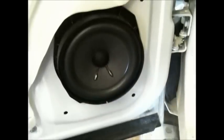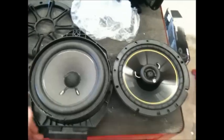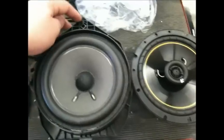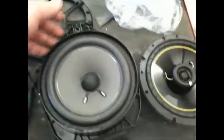And that's it, guys, and that's supposedly the best premium sound system speaker, Bose. Let's get that out of there. Alrighty, guys, here's the Bose speaker out right now. To remove it, all you need is a 7-millimeter screw that comes right out, and then this guy, just put a little flat screwdriver, there's a little bit of a seal from this gasket they have on there. Go ahead and get that out of there, and it pulls right out.